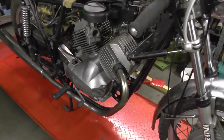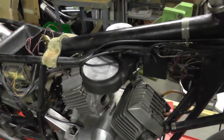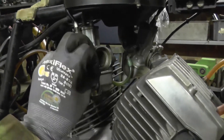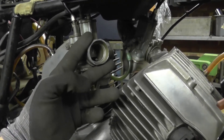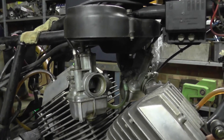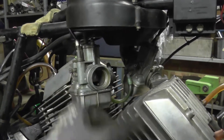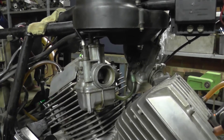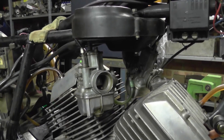It's an original exhaust system and it's still got its air box, which is good. I've taken one of the rubbers off which was split, and part of the reason it's split is that the little screw-on bell mouth on these early carbs is some kind of zamak and it's completely rotted and crumbling — which sometimes happens. So I'll have to source some plastic replacements; we might have to order them in.